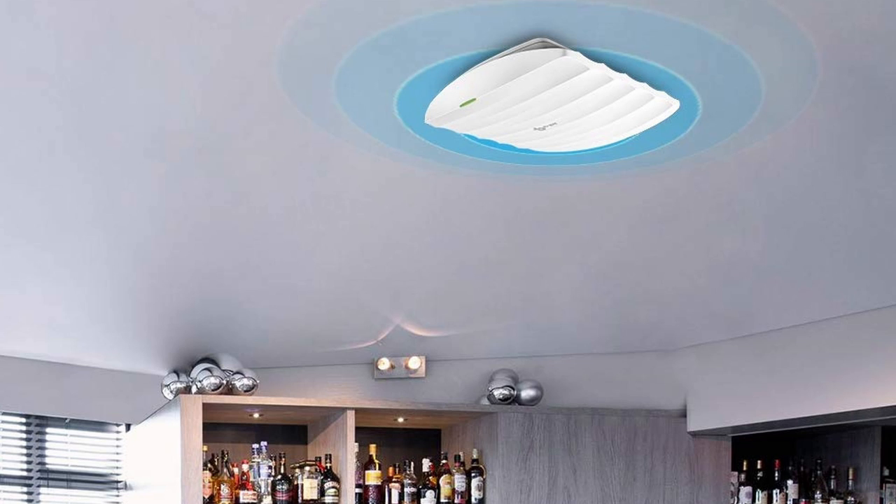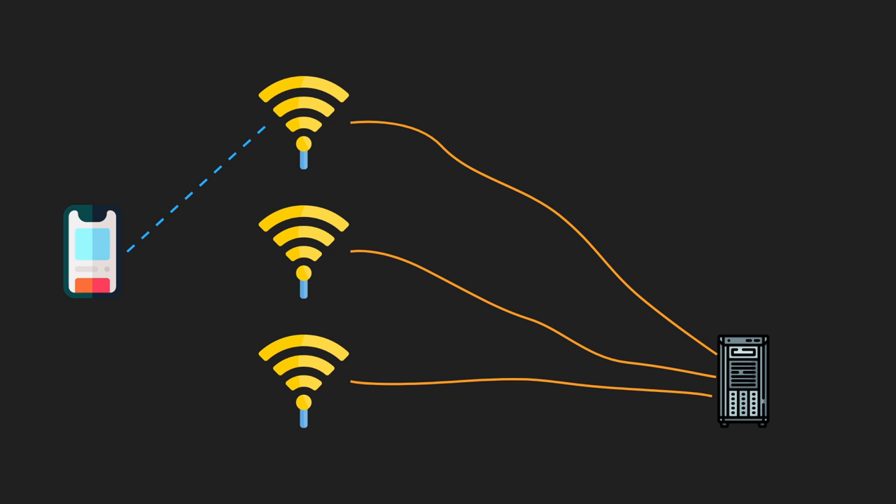Now let's go a step further — how do Jio, Airtel, Vi, or BSNL know which tower you are connected to and your approximate location? This is similar to how a network administrator knows which access point you're connected to. You may have seen circular disk-like Wi-Fi access points on the rooftops of hospitals, hotels, offices, and complexes. These access points only emit wireless signals — they have no routing functionality. All routing, IP address management, data throttling, bandwidth allocation, and QoS balancing is done at a central location. The network administrator can immediately know which access point you're connected to by simply firing a query.